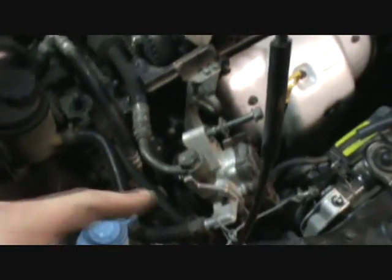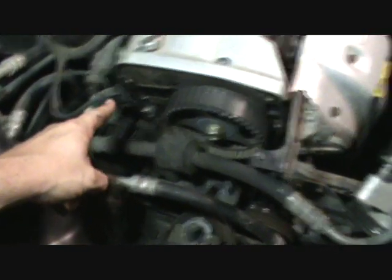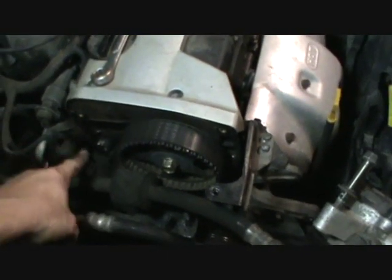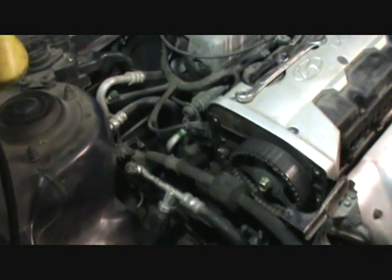Once you do that, you can go ahead and also remove the power steering belt and lay it to the side. And you will then need to concentrate on removing the air conditioning belt. Now also, when you're into this cover, let me add this. There's also another bracket sort of like this. It's back here. It's held on by these small bolts that hold that plastic cover on. Just keep it with them, but it'll get it out of the way. And so yeah, you do that.